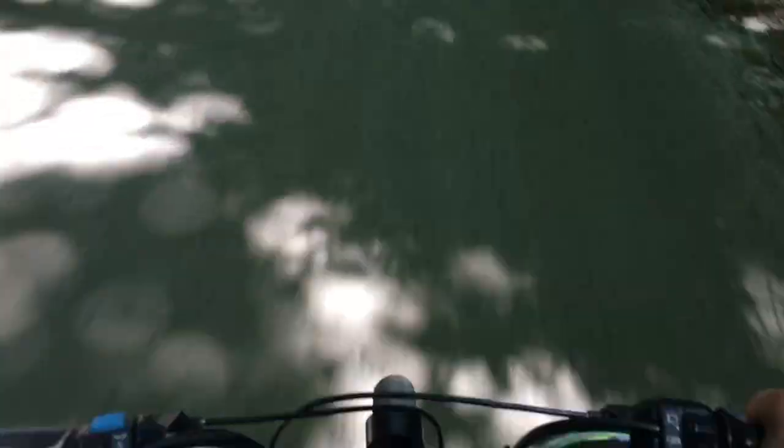It's got a really neat rear suspension linkage so the shock is completely horizontal, and even if you weigh like 400 pounds and sit on this thing, it's only going to drop like an inch. So you don't have super crazy chain growth or really saggy suspension. For instance, my Kuberg bike with my DNM RCP Burner 3 rear shock — even though I've got the heaviest 850 pound spring in it — when my 220 pound butt sits on it, it drops down like five inches. This one just drops an inch no matter what and stays in its sweet spot.